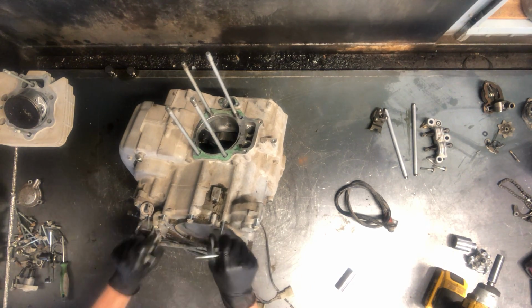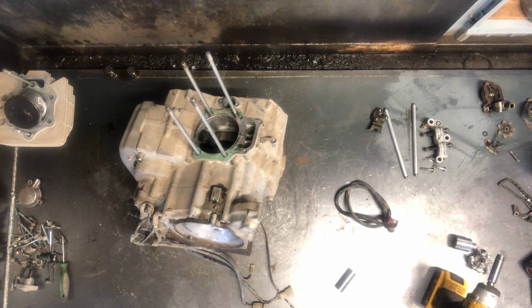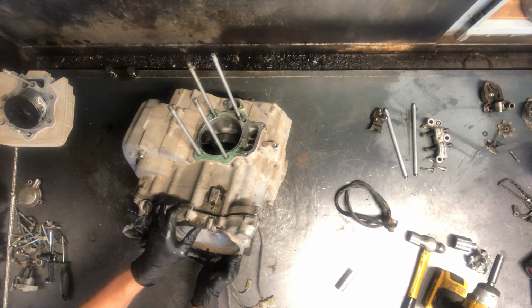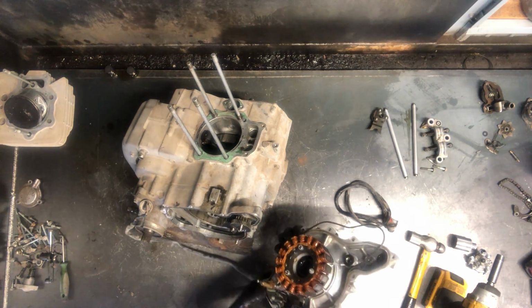When replacing your idler gears, which does need to happen every so often, you'll do the exact same thing. You'll pull this same cover here, gasket seal, but it does have a magnet in behind there, so this is going to be a little bit of a challenge to get off. Just pull it like that. That O-ring was holding us up too.